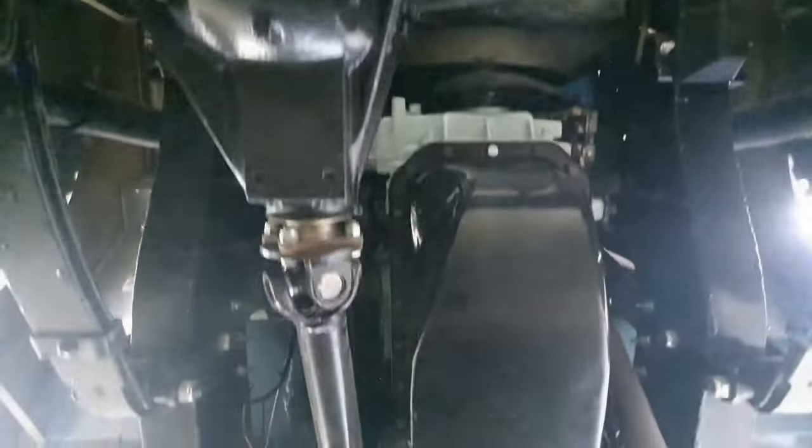With that I'm going to tell you the dirty little secret. This Land Rover now has different axle ratios front and rear. In the front is a standard 4.7 diff ratio as it came from the factory - it's not worn out. In the rear is what Ashcroft supplied. They don't have any 4.7s - they claim that they cannot get hold of any good ones. So it's a 4.75.